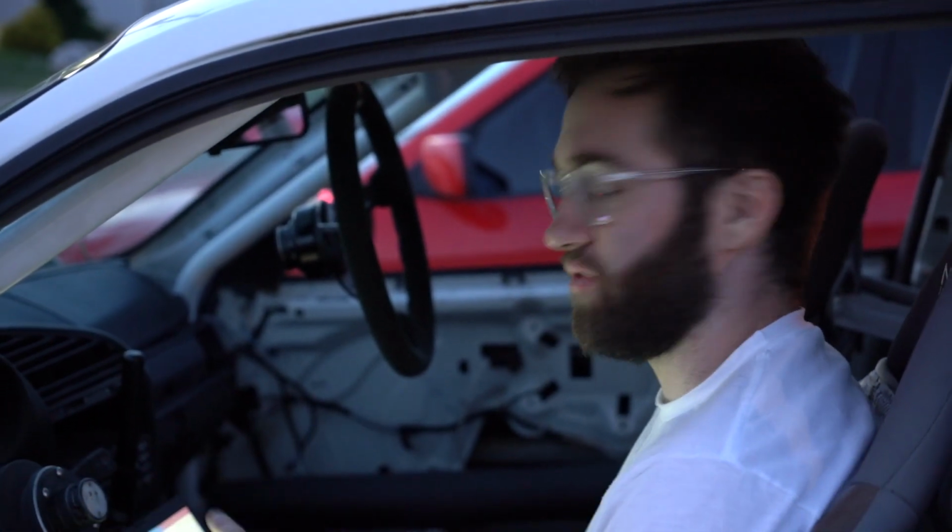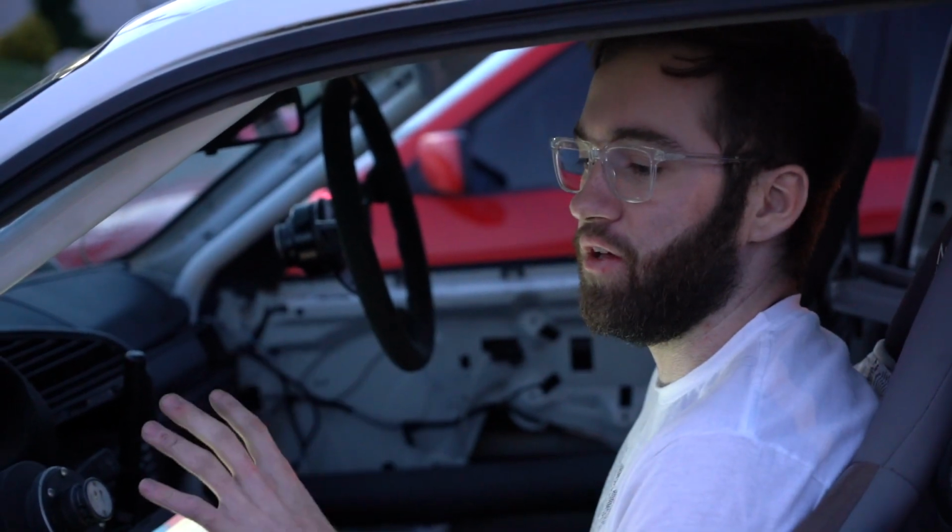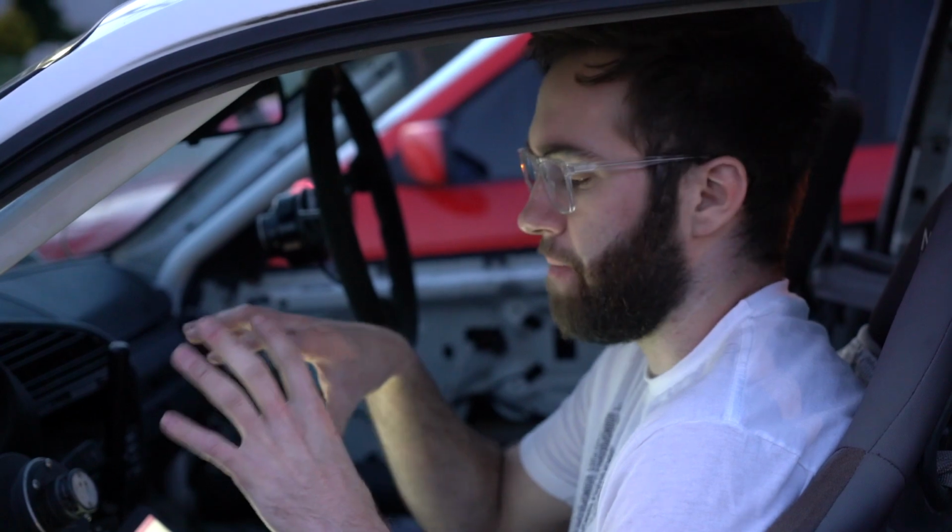They provide really good instructions on their website here. I must say, it's pretty foolproof for the most part. Now this will take 2 to 3 days once I email my file off to them. So essentially what happens is that right now I'm scanning my ECU, my stock ECU. You take that file and you send it off to RK Tunes, and 2 to 3 days later, they'll send you back a tuned file with an EWS delete, you can do a raised RPM limiter, crackles, burbles, and little flames if you want. So yeah, let me go launch my software and I'll get back with you.